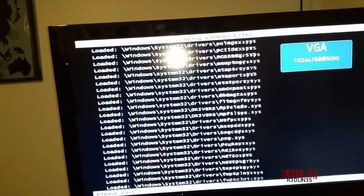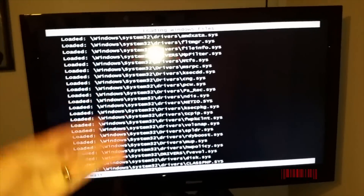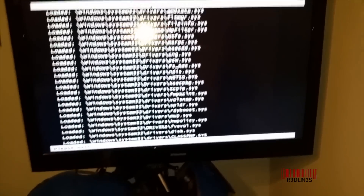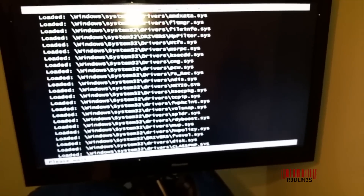I kind of already know that Safe Mode isn't going to work. But if you make it into Safe Mode, then you can troubleshoot from there because you're actually in Windows. Safe Mode is where it doesn't load all the vendor-specific drivers, so you might have a driver issue. You can also scan for viruses in Safe Mode.